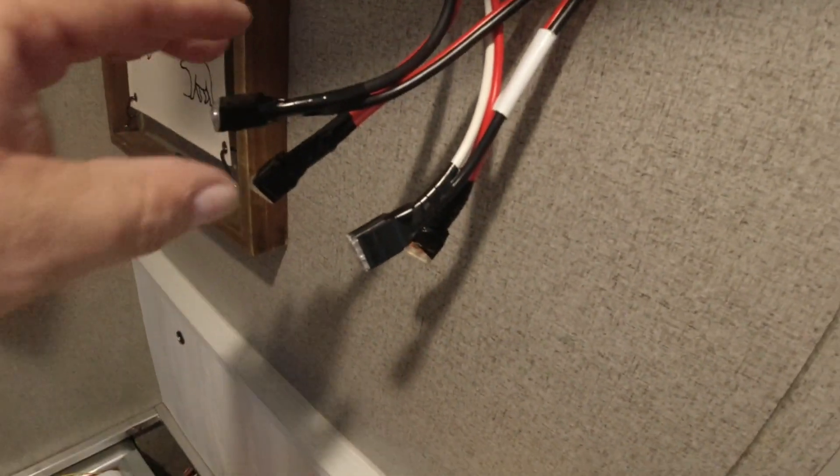To keep anything from moving around, I'm going to tape these wires really well so nothing gets shifted in here. These connectors should stay put, and if for some reason they don't, at least I can find where the disconnect is. Hopefully the tape will keep it all in place. Now I've got to tuck this into the wall and get my cover plate installed.